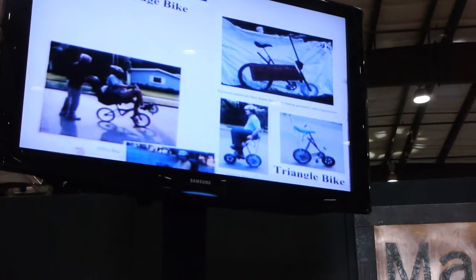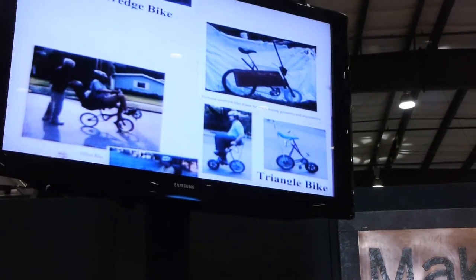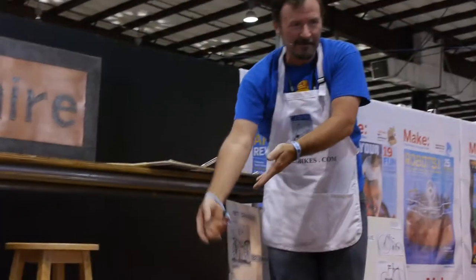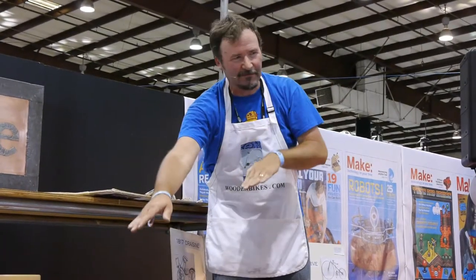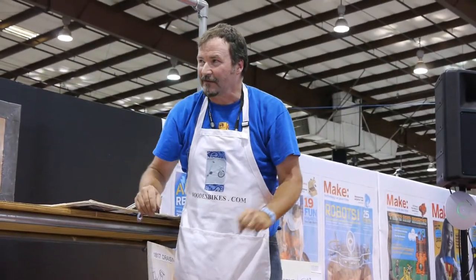From the little steel sandwich, I went up to this bigger plywood sandwich to the upper right. That plywood sandwich is holding the head tube. The head tube is separately bolted in from this one big seat tube going down to the pedal. I could separately bolt the seat tube to different seat angles and do semi-recumbent or more upright positions with different wheelbase configurations.